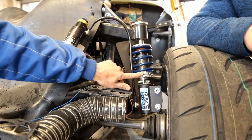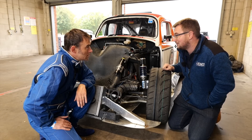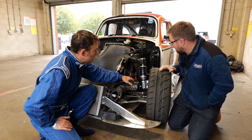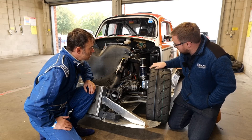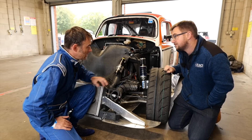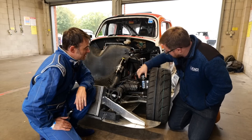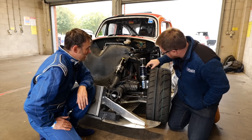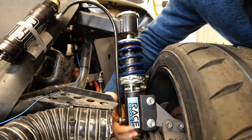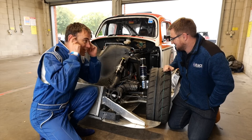It's also height adjustable. As Richard said, the car's balance has changed dramatically from its Fun Cup days, so we've taken the weight of the car into consideration, the damper angle, and calculated what spring is required for the vehicle. We do that in a split on a frequency basis front to rear. And to be clear, we've also had to make the strut itself — it's a complete unit with an internal piston and a remote reservoir. We made the whole unit basically.